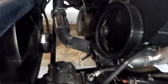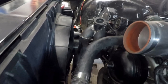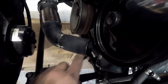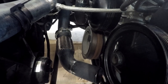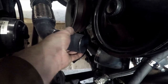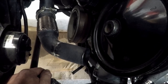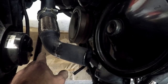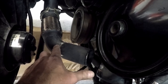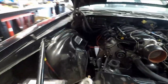I ended up with this piece going into that piece — some more ugly welding, but the crossover is almost done. There's a bit of a mismatch here because I ended up moving the whole piece further away from the fan shroud — I realized it was getting too close, so I clocked it a little bit. You can always add metal — remember that. A 40-grit flap wheel on this stuff is very good for shaping. I'll cut this on a different angle and put a longer piece in here; I've got a lot of material left from the original kit that'll line up nicely.